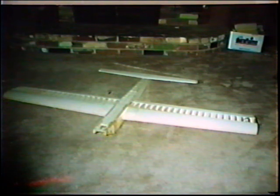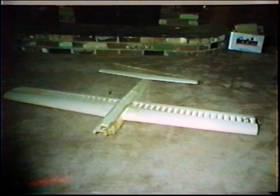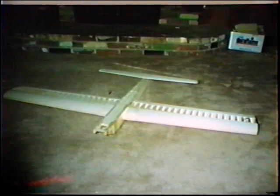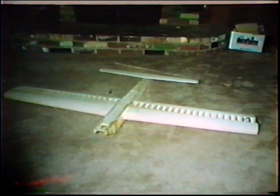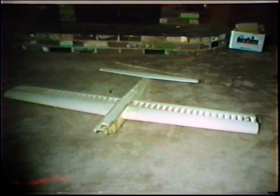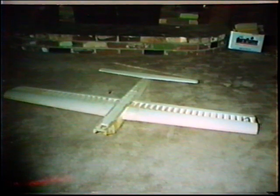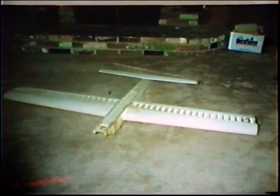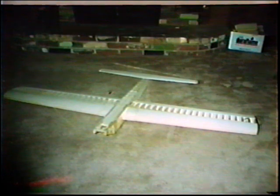Well, there's a lot of things you can do, and you can pick most of them up off the engine tuning videos, but basically if you're running too much fuel, I'd say more than 6 ounces of fuel in a 60, you should be thinking about a Hemi head if you don't have one already. Some more head shims, a little less compression, a little bit smaller venturi, and 5% nitro. Just some of the alternative things to get better mileage if you need to. Or you just buy a bigger tank, have Doug Taffender make you up a custom tank. Anyway, Jack, appreciate it a whole lot.